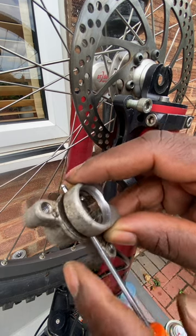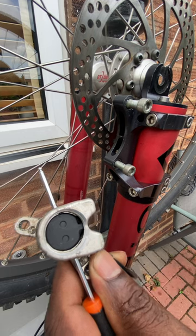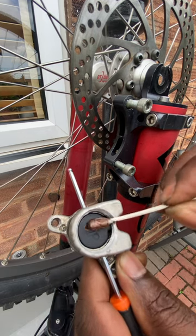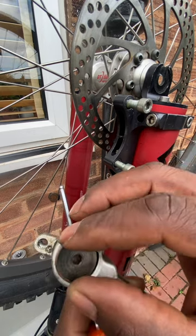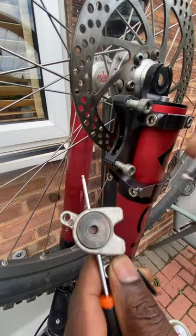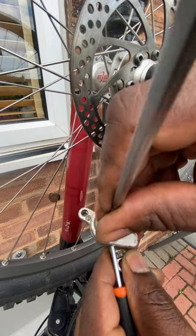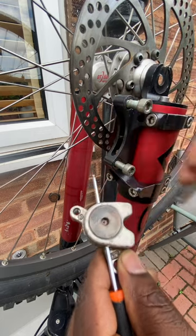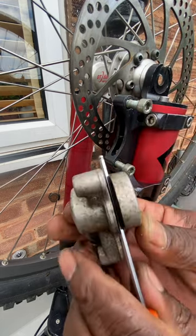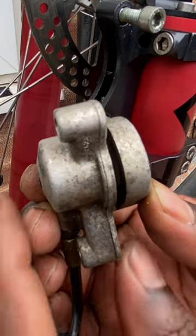I'm going to put a bar in between the two because I've got to fit the second brake pad. I'm also putting a bit of copper slip on the back of that one. Then I'm reinstalling the brake pad adjuster, which is magnetic so the pad will stick to it once it's in and should hold them apart. I'll screw it in a little bit because I need a gap to put the cylinder back over the discs - you can see the gap between the two pads there, which is good.